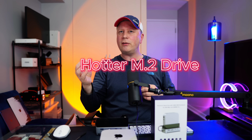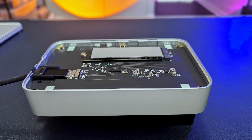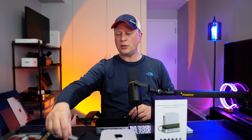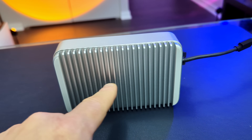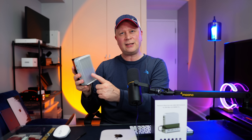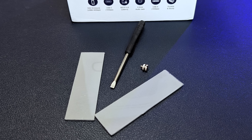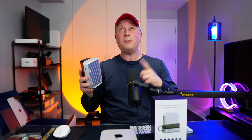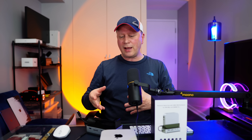One thing to note: the Western Digital SN771 runs fairly hot, so you need to thermally cool it properly. When you put the drive in, make sure you have enough heat tape so it touches the bottom of the metal plate. That thick metal plate acts as a heat sink — but if the SSD isn't touching the thermal tape and the tape isn't touching the back plate, it's doing you no good. Use both strips if needed, or get thicker tape. The dock will feel warm, which means it's pulling heat from the SSD into the plate. That's okay as long as the contact is made correctly.